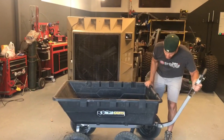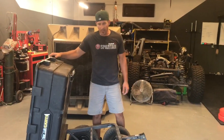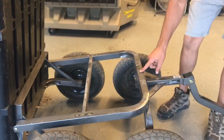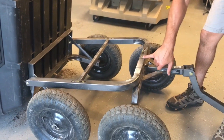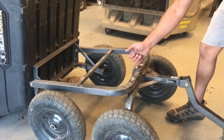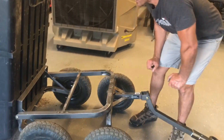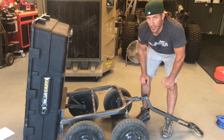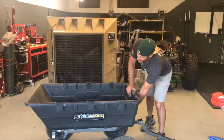The second con: if you're going to be hauling heavy weight behind an ATV or tractor on a constant daily basis, there's a potential issue. Another YouTuber pointed out that the pivot point — where the front axle goes up and down — puts a lot of torsion on the bar welded through the tube, and he had developed a crack around there. To reinforce it, you'd need to cut in a thicker metal plate. For most people using this for lightweight stuff or occasional heavy hauling, it will be more than strong enough — but if you need to haul a thousand pounds daily, get a stronger cart.